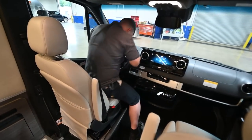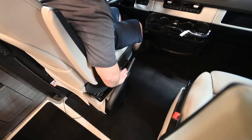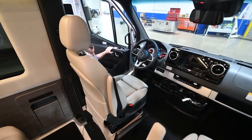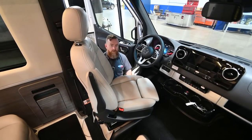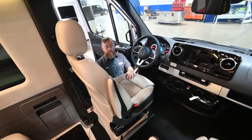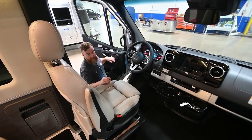We're going to go over the dash. First, let me show you how to disengage the European-style parking brake. What makes it European is that once it's engaged, you can actually push it down and that allows the seat to swivel. Make sure you run the seat forward to clear the B-pillar, and when you go to swivel the seat, I only want you to go 180 degrees. The lever is here in the front of the seat. There is a wire that feeds up to the airbag on the side of the seat — if you go 360 degrees, you'll eventually pull that wire too tight and it will break free. It's simple to reconnect, but it will trigger a warning light that requires a trip to the Mercedes dealer to have turned off.